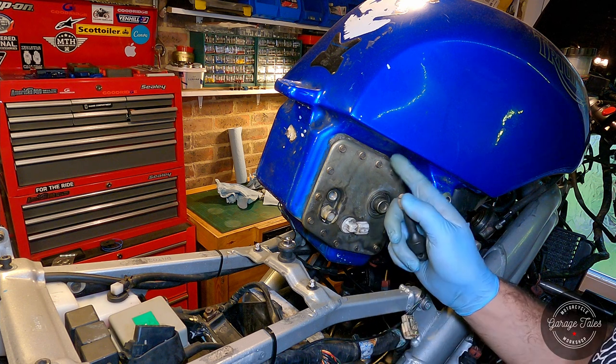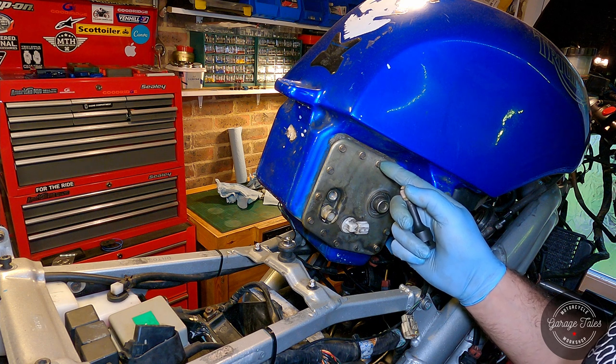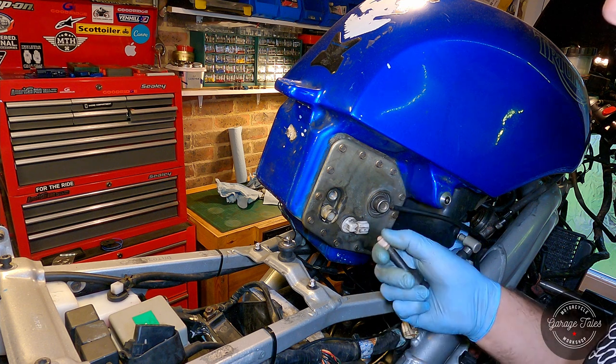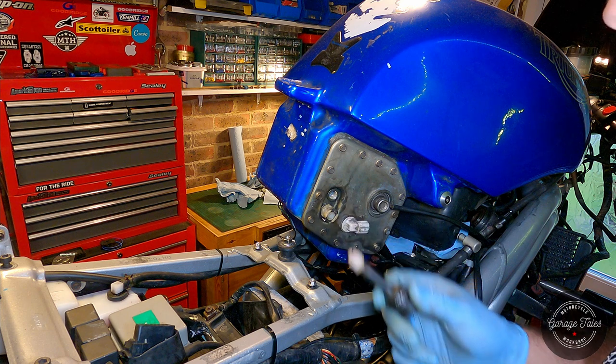Funny thing though, this is almost empty. It's more dangerous to have an empty tank full of vapors than a tank full of fuel. Because it's just fuel, no air, it's not gonna do much. But if it's full of vapors, it's gonna blow. So yeah, use common sense, be careful when you do stupid things like that.